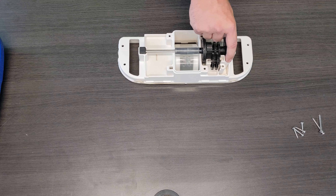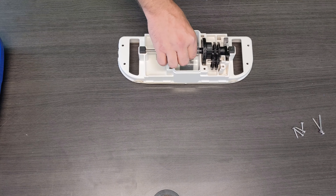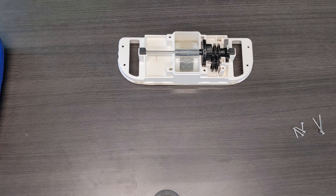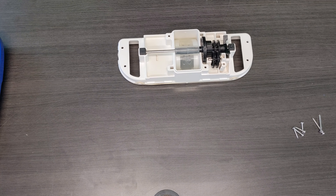The cam is actually this three-armed gear over here on my left, which is your right. This cam is what will actually help change the direction of the cleaner. As the cleaner gets suction and this oscillator ticks back and forth, eventually this cam slowly turns and will actually change the direction of the cleaner. There is no specific mechanism or set pattern — it's all randomized. It merely runs to a certain point until it tells it to turn, so it may leave some lines on the pool floor and then on its next go-around may go a completely different direction.